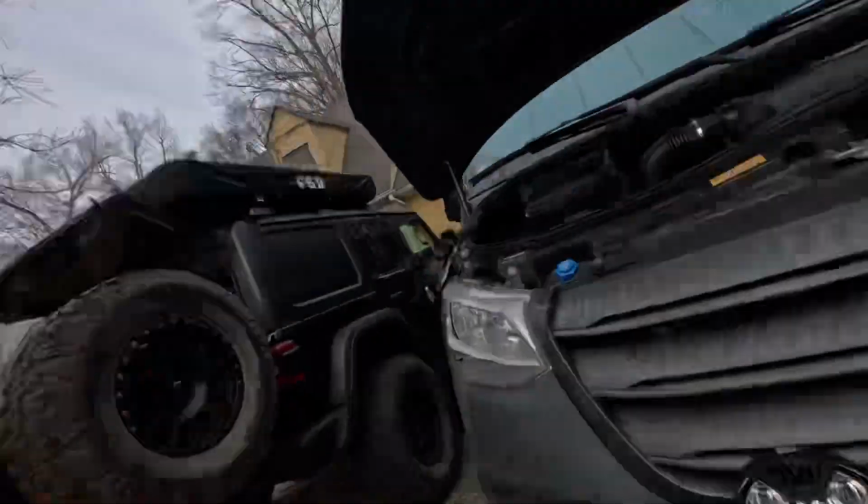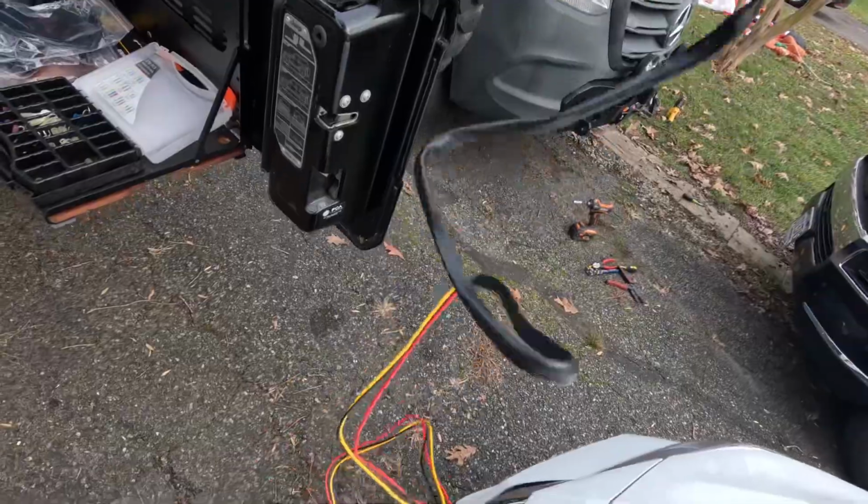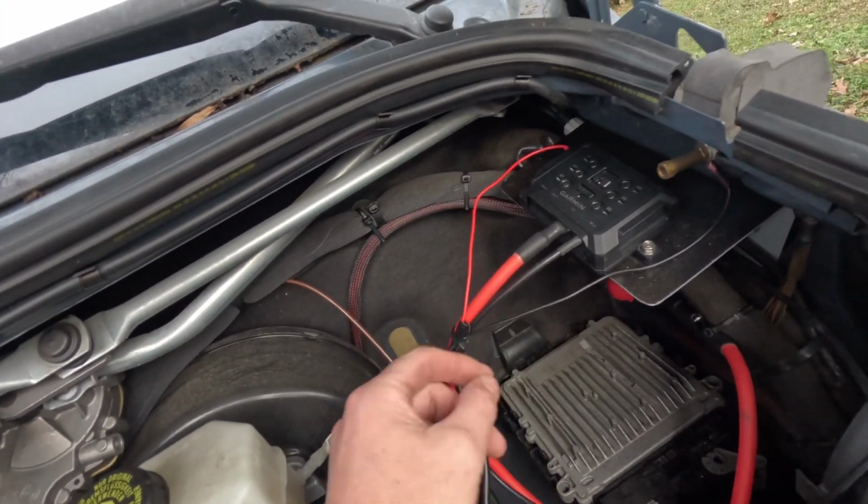They're pretty simple. They just mount to the holes in the bumper with a bolt and a nut and a lock washer. And then the KC lights come with a wiring harness with waterproof connectors, and we just made those connectors. Now that wiring harness that comes is designed for a switch. It comes with all of this. So we cut that off because all we needed were the 2 wires that go to the switch itself, which are a power wire and then the ground.